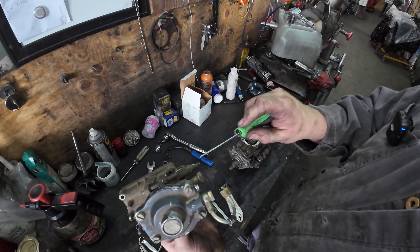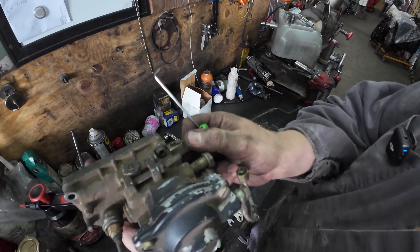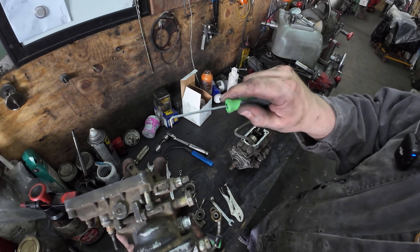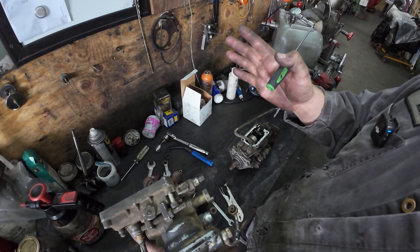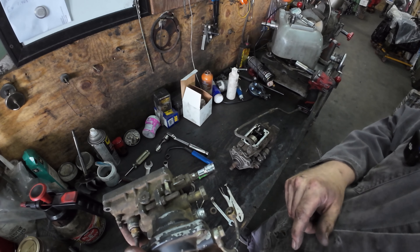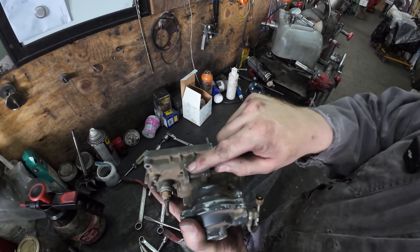Tim at Decent Garage - I think he used a 45-degree one. I found that the 90-degree one works well because you can stick it in there kind of like a screwdriver in the slot, and then the hole for the lock wire is 90 degrees from that. So you can stick your pin end in there and turn it - it's not that hard to turn as long as you're not up against your jam nut. Then grab a 6mm socket and wind this in on a ratchet until you get your desired RPM.